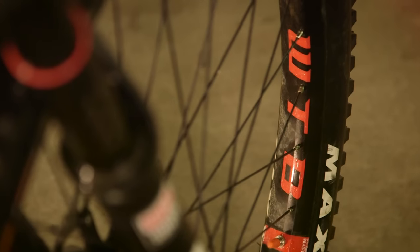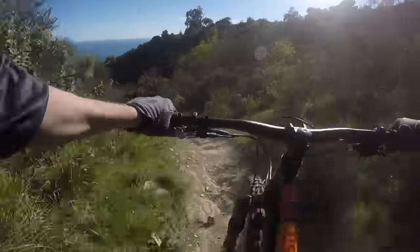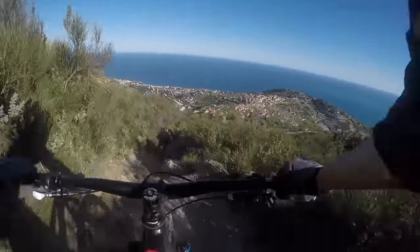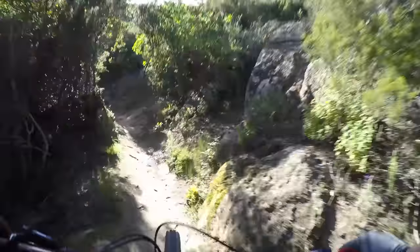The other thing I really noticed on the Kona was the wheel and tyre package. It has Maxxis Minion DHF and DHRII tyres mated to a 35mm internal-width rim, which gives them an incredible profile — really aggressive on the shoulders. That combination probably wouldn't work with many other tyres on the market, so if you're going to upgrade I'd go for something very similar. The rear end tracked superbly, the Pike worked nicely, and you had massive grip from the front end. If you look at the spec sheet you may well write it off, but the ride quality is up there with the best.